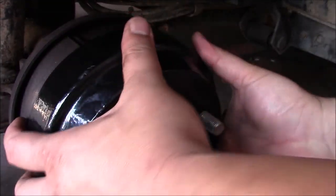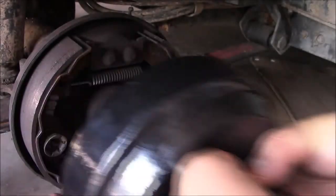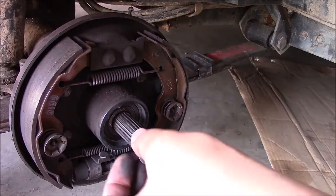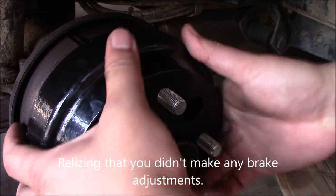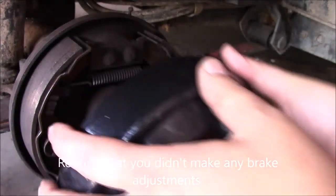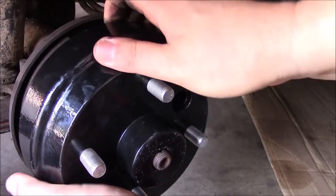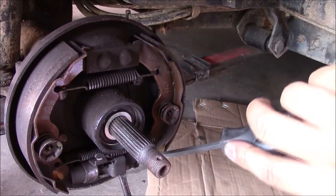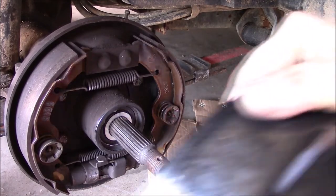It fits the splines well, but you can tell there's going to be a little drag. You can see there's a small chase line on it. It comes with hardware so I'm going to put the retainer on the inside and line it up. I lifted up the pad a little bit using the star wheel and gave it a couple of turns in, then we'll try the hub again.